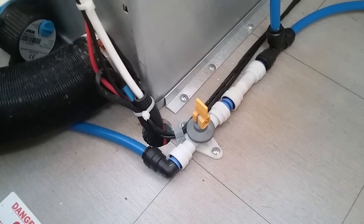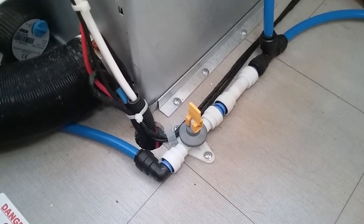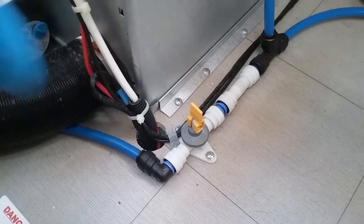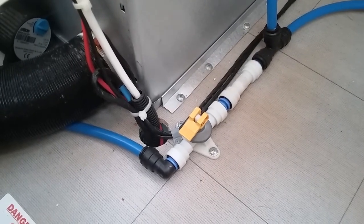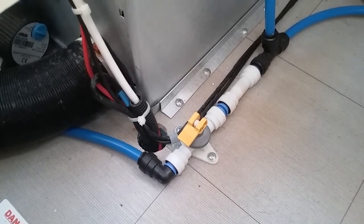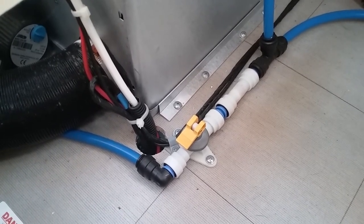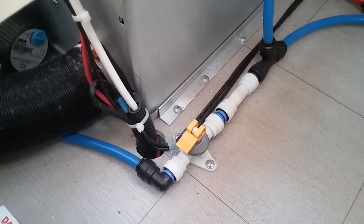Before draining the boiler, always make sure the water pump has been turned off. If you are winterizing the caravan, also go around and open up all of the taps as well, because this will help release any airlocks in the system and help it drain off far more efficiently. When it comes to refilling, re-close the lever, close all the taps, fill up the aqua roll and drop in the submersible, then turn the water pump back on and it will begin to refill the boiler. Allow it to run for a few minutes, then begin opening the taps — they'll cough and splutter as they force the air out. Once water is running freely on both hot and cold, re-close and the system will fully re-prime itself.